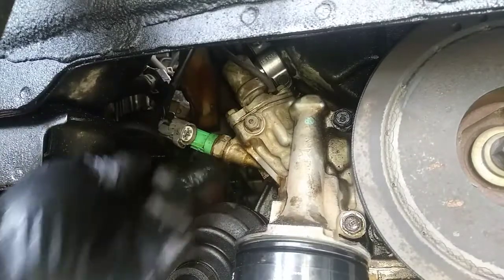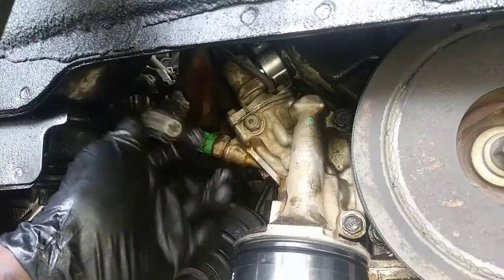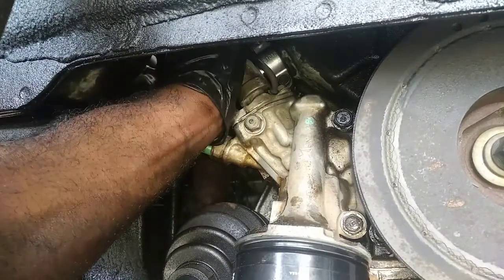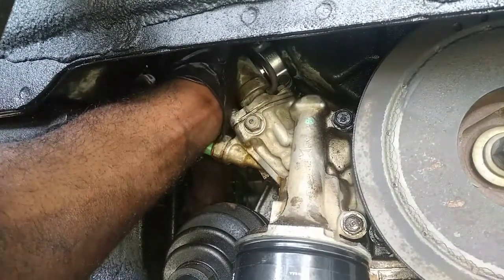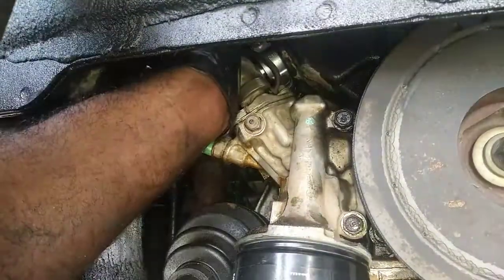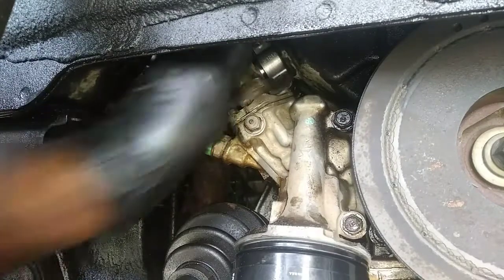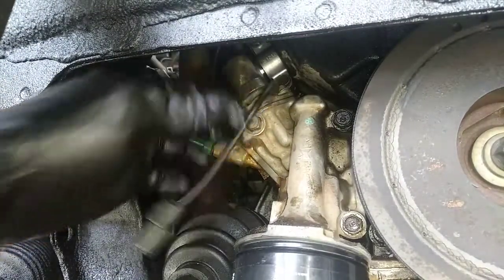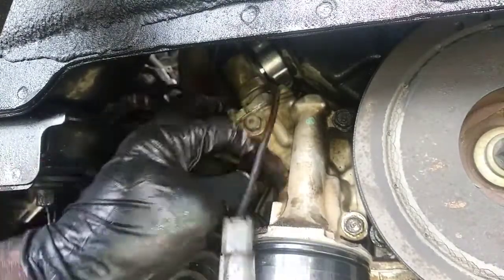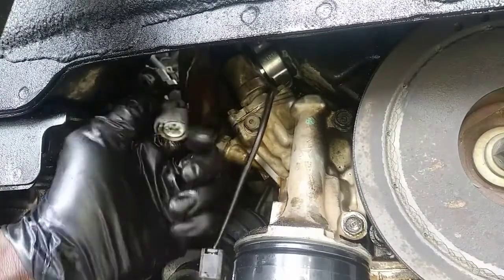So they've got a pressure switch here. You see the clear liquid. That's some of my brake cleaner. I've sprayed around here. I've used like 3 cans on this car. It was pretty nasty. And I'm reaching up to remove the solenoid connector. Ouch. Damn, that's hot. Alright. The connector does reside on a bracket, so no big deal. So I got the VTEC connector removed, and I got the pressure switch removed.